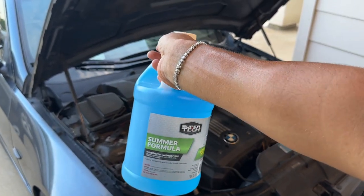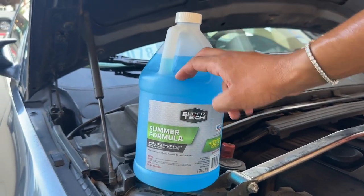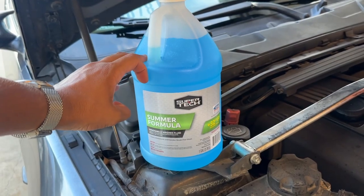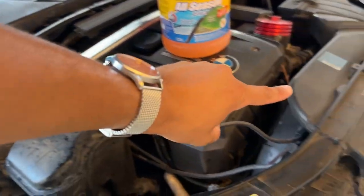You only want to use the blue summer formula. The summer formula is basically bare bones — it's essentially just soapy water — and it will not clog the little motor no matter how long it sits in your car. A good rule of thumb is that anytime it comes to BMW, buy anything blue, as you know with the coolant, etc.